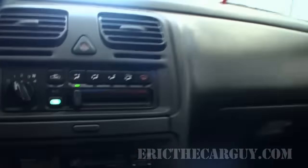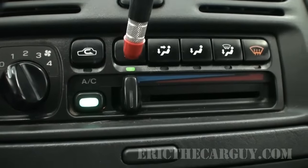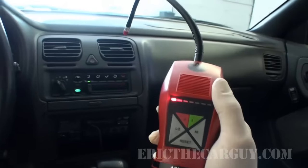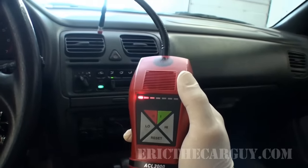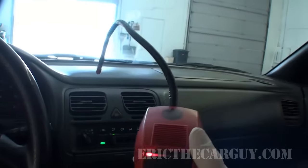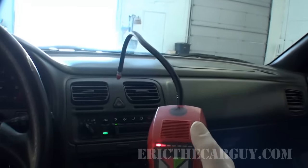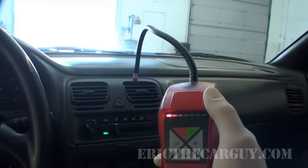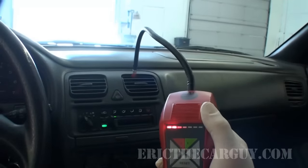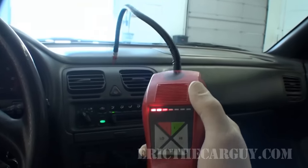If I'm looking for leaks with the evaporator, I often use the sniffer tool to find those leaks since it's up inside the dash and you can't necessarily see the dye. What you might be able to see is if you look at the evap tube — if there's dye around the outside of that, that's usually a good indication that something is leaking inside. It may not be the evaporator; maybe it's an expansion valve or something, but you really won't know exactly what is leaking until you get inside the dash. So be prepared for the worst. I turn the air on low, turn the AC on vent, then get my sniffer and just sniff around the area of the vents for any refrigerant.